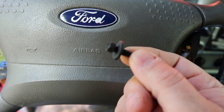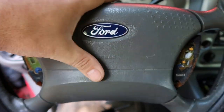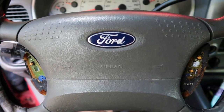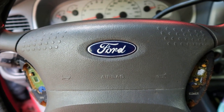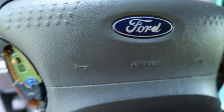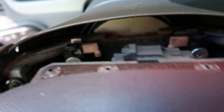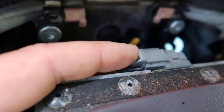I've got the two bolts out and they are eight millimeter, or five-sixteenths. So the next thing we're going to do is take this airbag out. I've had the negative battery cable unplugged for about 15 to 20 minutes. What I do is leave the door open, turn the ignition switch on, and turn the headlights on — just in case there's any residual power left in the system, to drain that out. Now we're taking the airbag out. You'll see this yellow wire right here — that's your airbag connector. Just push down on this little tab and pull the connector loose, then lay your airbag to the side.